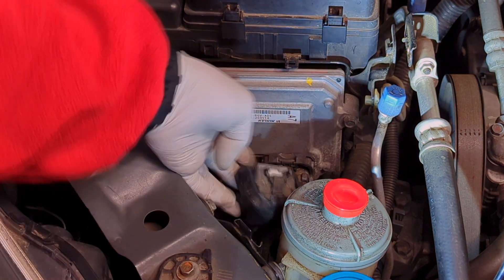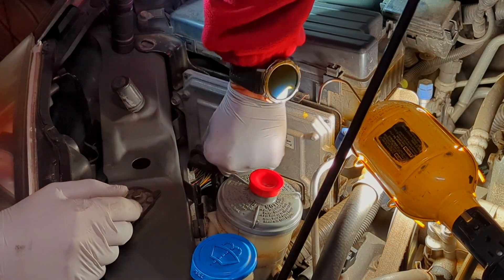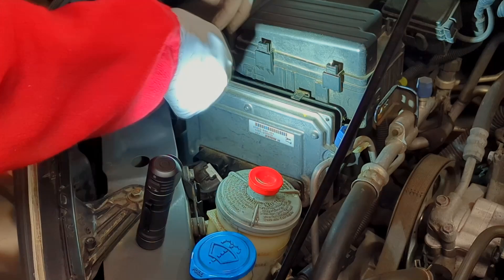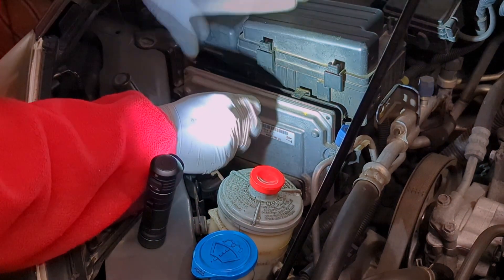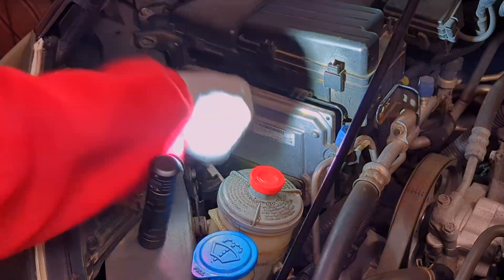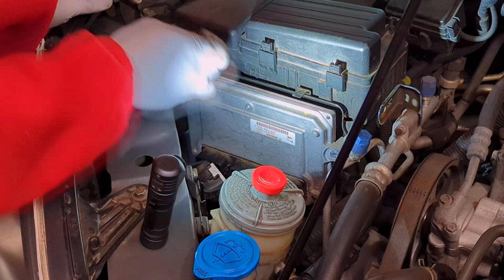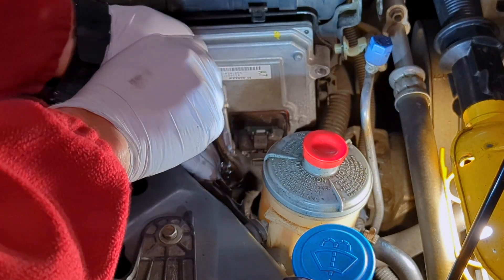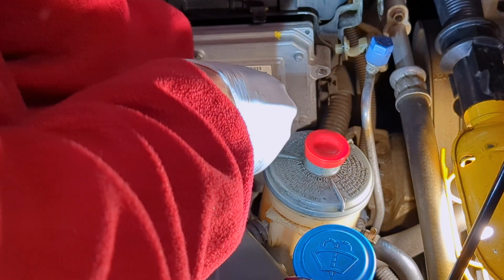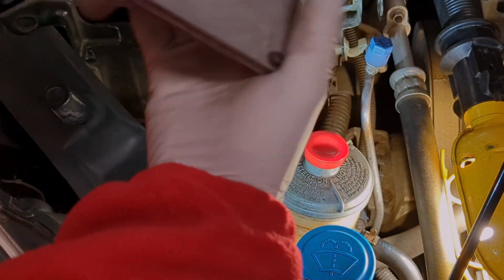Press this tab, and then you can push this down — press it and push down — and then this can be removed. Press it and then pull it down. Now from another angle: press it, pull it down, and then it can be easily removed. Also 10mm. In this tight space, this one is easier with a box wrench. It's difficult to reach, but there is one more bolt securing the PCM module down there. Okay, finally — now we can remove the module.